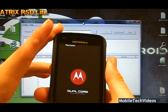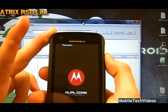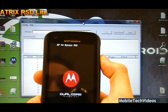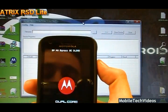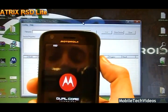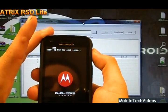Now we want to review some of our options. To review the options, press volume down. When you're ready to select, press volume up. Volume down gives us fastboot, NV flash, BP hardware bypass RSD, BP hardware bypass QC deload, and a lot of other stuff as well. So we're looking for RSD — just plain RSD. Once we've reached RSD, press volume up.